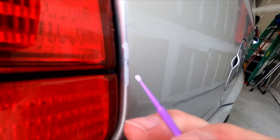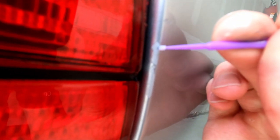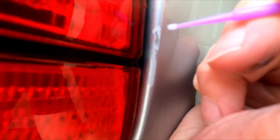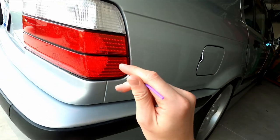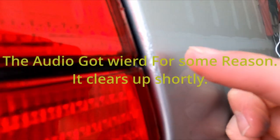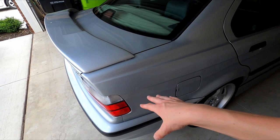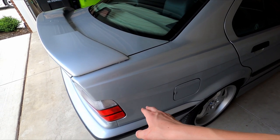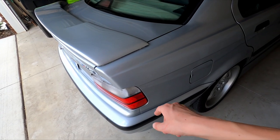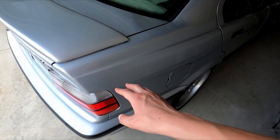Over here, I actually scraped this up when I put these taillights in, so I'm just going to get my paint on this and go over it. Because there's no rust here, you can just go right over it and be perfectly fine. You can see that looks way better now — it's a little messy but it's better than bare metal. The reason you want to do this is because bare metal will start to rust if you leave it. It's better to hit it now than to wait and have it get infinitely worse. If you really want to go an extra step, you can buy a cheap clear coat and go over it — I think it's overkill but it's better than nothing and much cheaper than actual paint work.